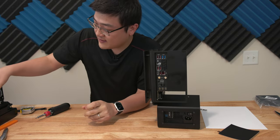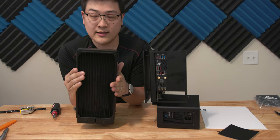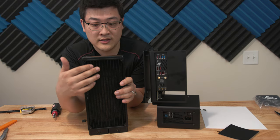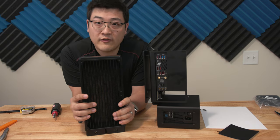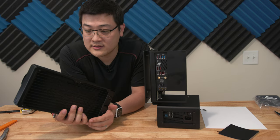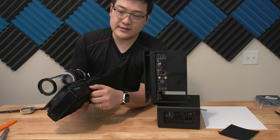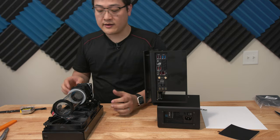Let's talk about the water cooling stuff. I've already mounted some of this together. What I've got is a 280 millimeter Alpha Cool radiator — this is the XT45, meaning 45 millimeters thick, and I think it's got about 16 FPI or fins per inch density. So this is a little bit denser than the normal UT60s or ST30s. Considering the amount of heat I'm going to be outputting, maybe up to around 600 watts, a 280 millimeter should be okay. 280 millimeters is like 90% of the square area coverage of a 360 millimeter radiator, so it's almost equivalent.